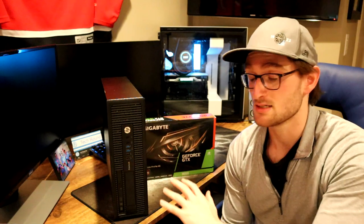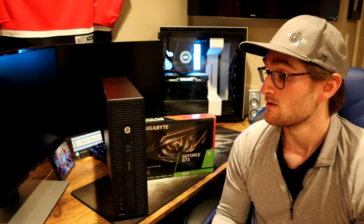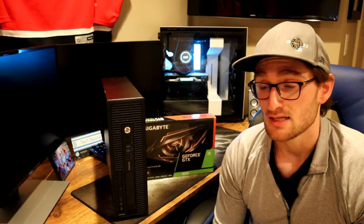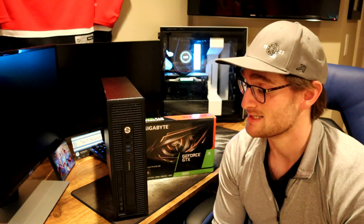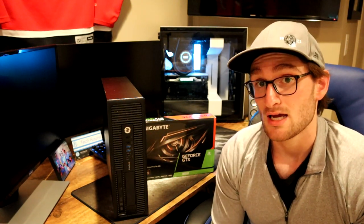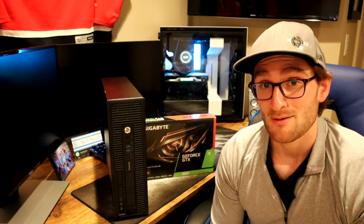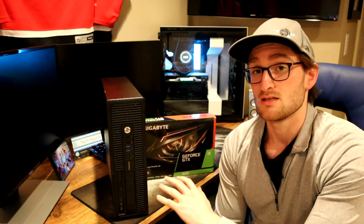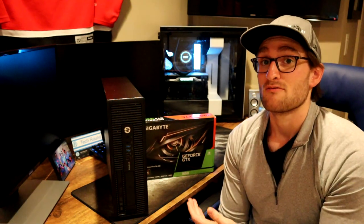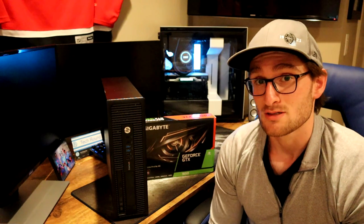We'll go through the process of opening up this case, looking inside, seeing how you would upgrade the RAM, and we're going to show the graphics card installation. This one already came with an SSD, but I'll show where it goes, how you'd replace it, and where your SATA ports are. There's also the HP 8300 SFF build — I'll put the link in the description. There's Lenovo ThinkCenter and Dell Optiplex SFF PCs — plenty of opportunity to go with one of these already built systems from HP, Dell, or Lenovo with a third or fourth gen i5 or i7 and just throw in a graphics card. These processors are still going strong for gaming.